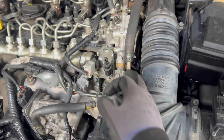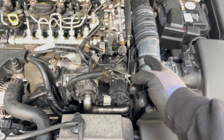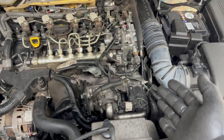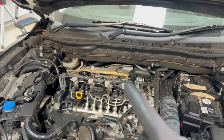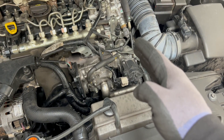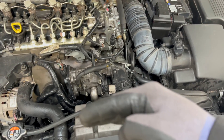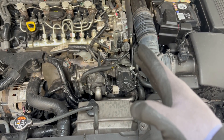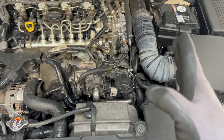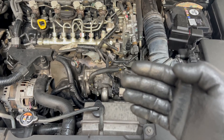The vacuum pump is here. I'm basically going to pull off that vacuum hose and put a gauge in there to check. Then we're going to start up the car and I'm going to be monitoring the vacuum — how fast it pulls the vacuum, and when he applies the brakes, how far it goes back and how fast it comes back to zero.